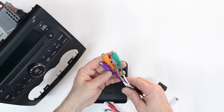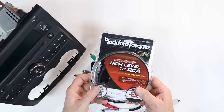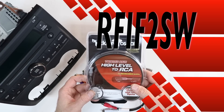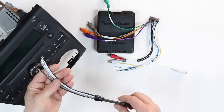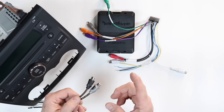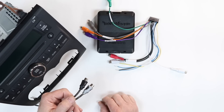If you don't want to cut your RCA ends off and hardwire it, Rockford has thought of that. They make the RFIF2SW — a high-level to RCA adapter. Inside you have a set of speaker wires that you can connect to your factory harness and drop a set of RCA outputs, then run a set of RCAs from there to wherever you have your DSR-1.